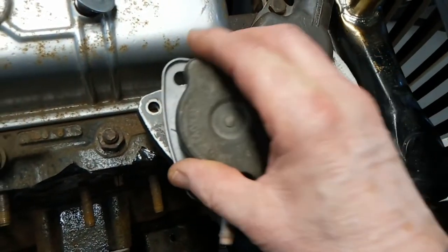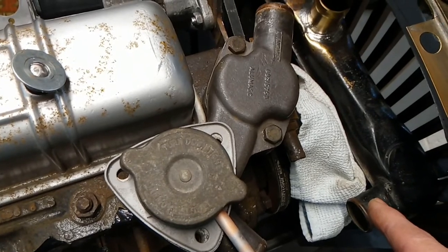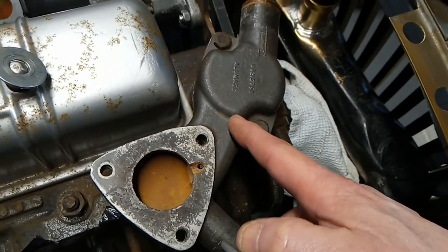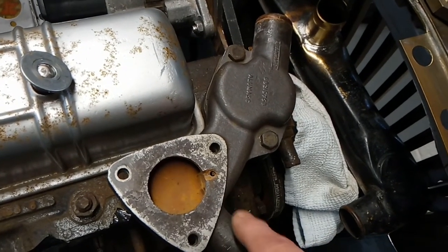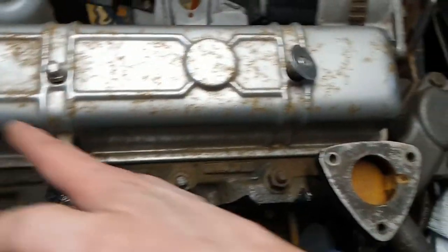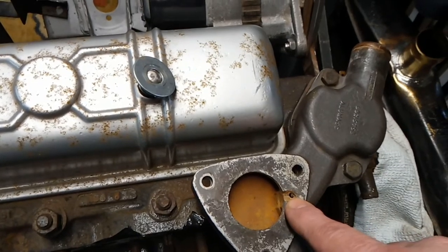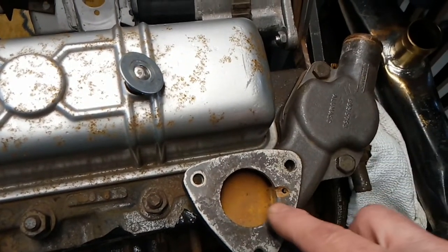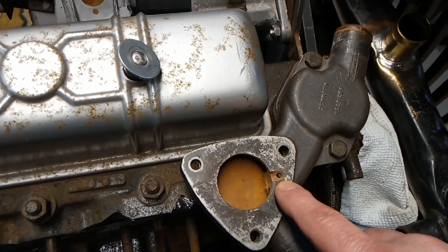On this side is the filler — straight into there. The only thing that connects the two halves is a very small vent hole, because it's blocked off inside. As you're filling up through the radiator, the coolant goes through the bottom hose, through the pump, and into the cylinder block. When it comes back up, it will vent through that hole, allowing you to fill it up completely. Once there's a gasket on there, there will still be a little hole.